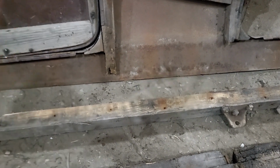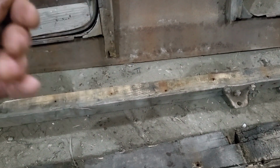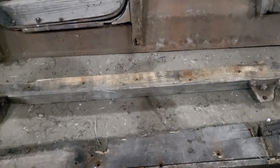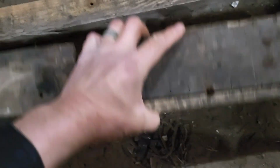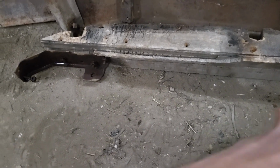So the wood structure is completely fabricated, and then the metal is attached to the wood skeleton, which, like I said, wasn't the way I had envisioned that it worked, and so the way I envisioned taking it apart also didn't work. But I did manage to get this apart without wrecking it, so that I have a template now for this frame rail, and then this top cap that forms this L-shaped main frame rail, which is literally what I call it. I guess the body frame rail.